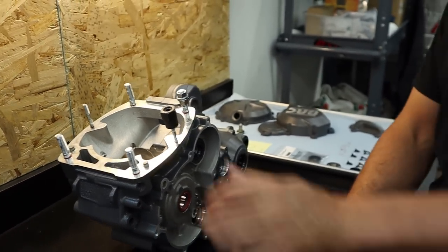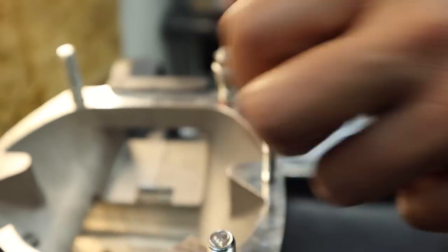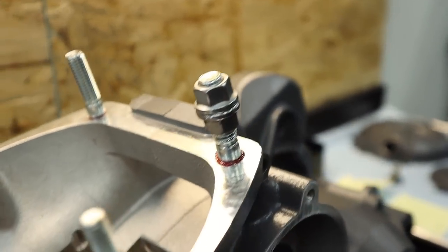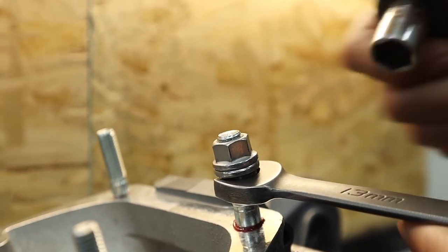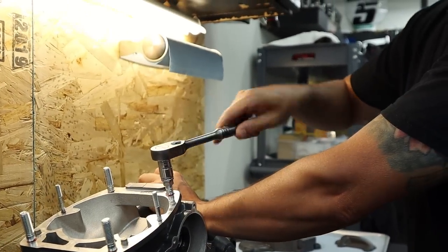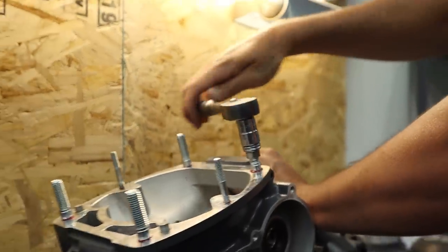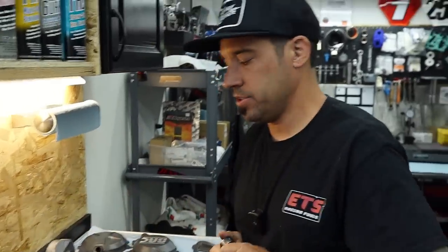And in the event that you don't have one of those, we go with the old double nut. The old stuck nut. Oh, I see what you did there. The stuck nut together. You guys have probably done this before. In a pinch, you cinch it up, flange side touching flange side, and you get a good bite. That way it will spin our stud. In lieu of that tool, you've got something to bite onto. They can slip a little bit, so you just gotta be careful.